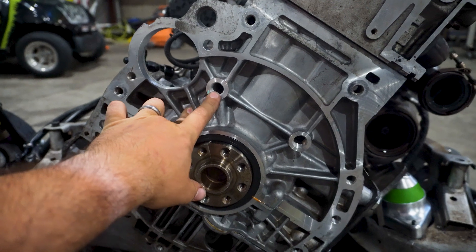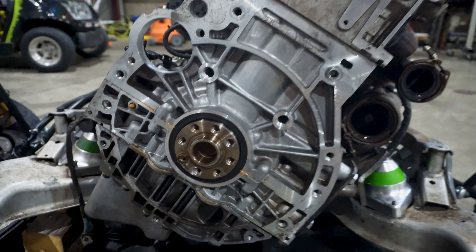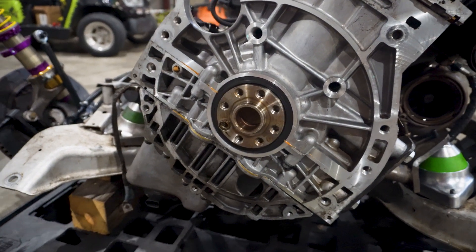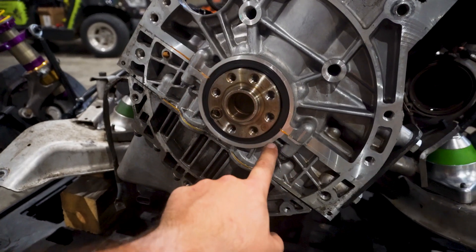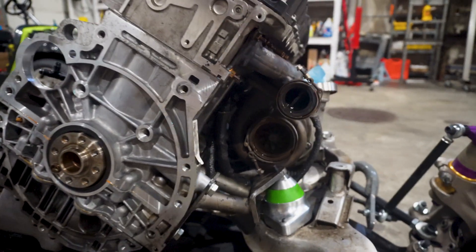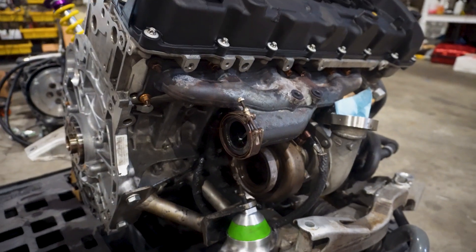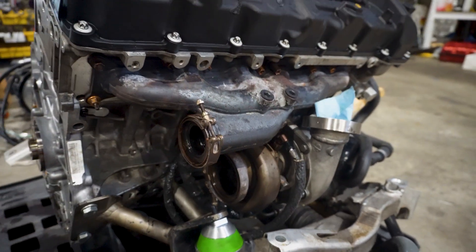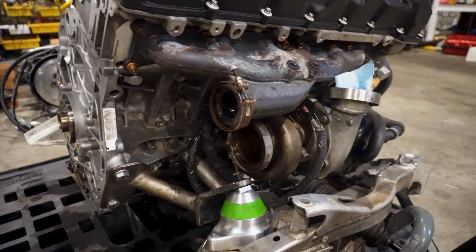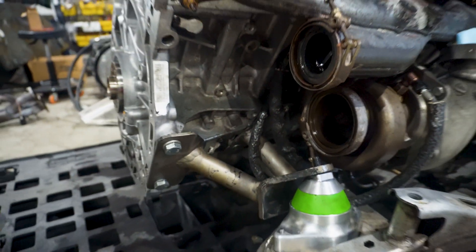I removed the freeze plugs and just drilled and tapped these with NPT plugs because it was easier. I'm going to pop those back in. You can see some of the orange Loctite seeping out. She might be a tad heavy but it is touching the rear main, which I really like to see because that means it'll have a good seal. Toss the starter in. Everything for the turbo is done - it's a pretty tight package back there. I'll probably throw the downpipe on right after the transmission. All the AN fittings and feed lines are tight, and everything is wrapped in really nice heat shielding so it basically lives in hell.